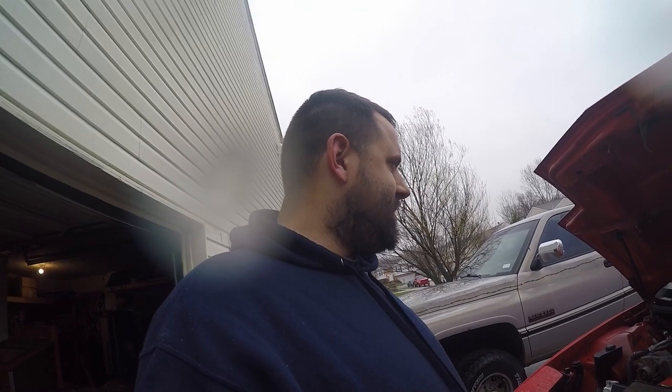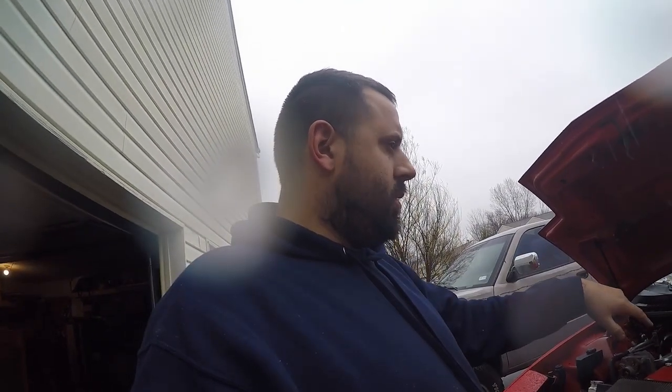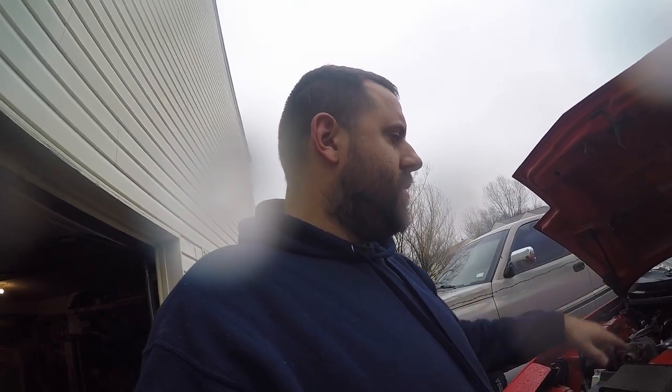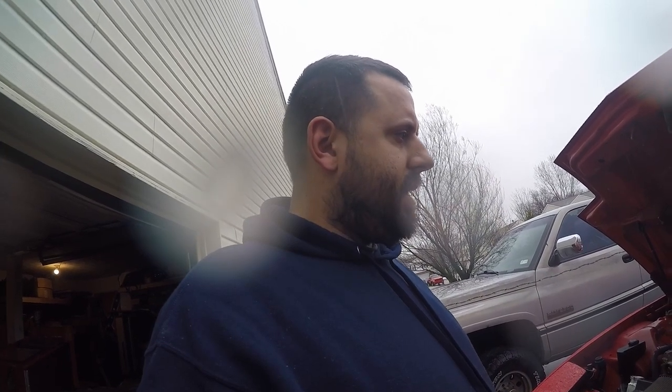As you can see, the car's got spark. I think everything is fine as far as electronics. I think what happened is when I timed my distributor — you've got to have number one on the compression stroke, then put in the distributor — I'm guessing I got that backwards and the distributor's off 180 degrees. I just have to pull it up and swap it. Should be pretty easy. She's alive!